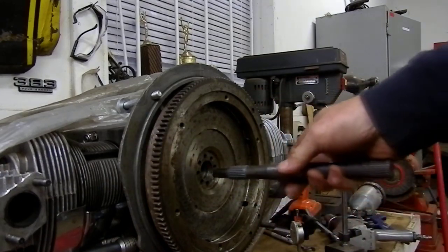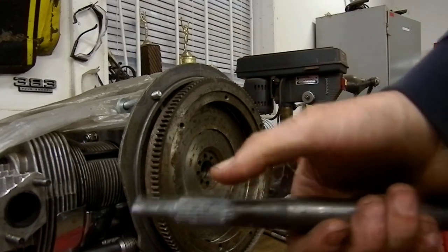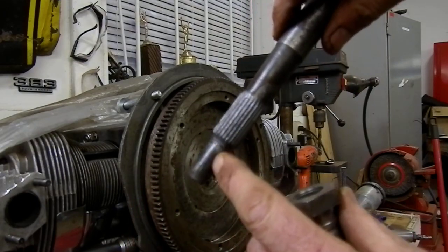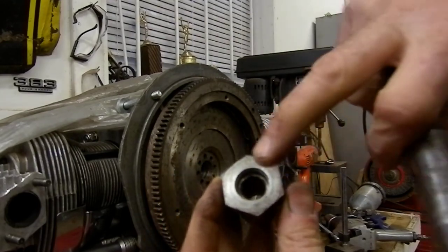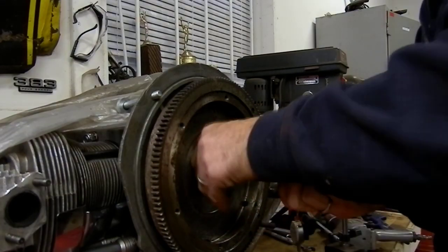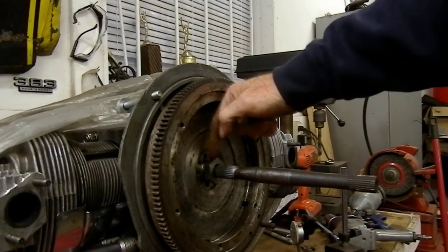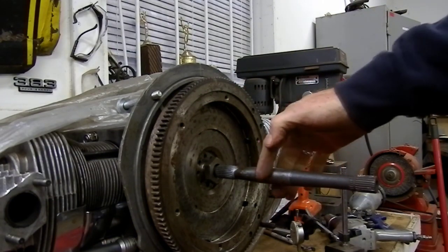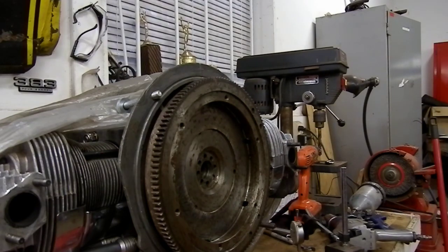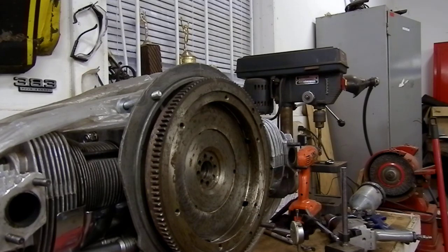I have a transmission input shaft right here — this is where your clutch would sit, splined to the input shaft; this is an old one I use for aligning clutches. This portion of the input shaft is the mated bearing surface for the needle bearings inside the gland nut — it sits like that. When assembled and torqued, it pilots that end of the shaft, and the bearing in the transmission supports the main shaft. This engine is built up to be an 1835cc — probably looking at somewhere around 120-plus horsepower. That's a demonstration of crankshaft end play.